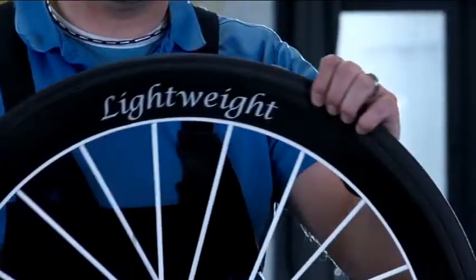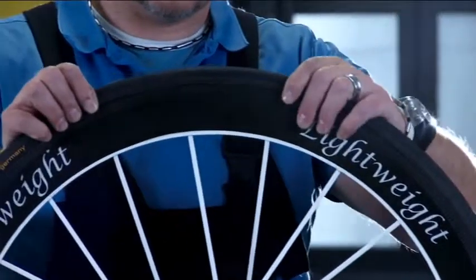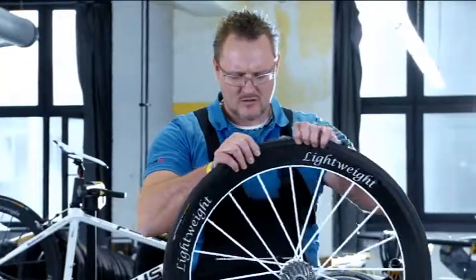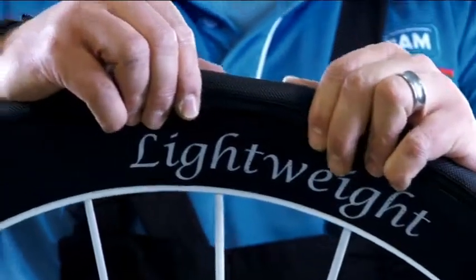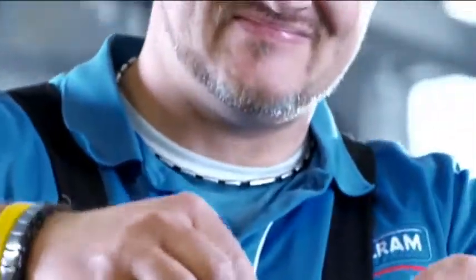Once the tire is in the bed, it must be centered and aligned. Very seldom does the tire run true immediately. Check the tire over the entire circumference. The seam protector must be aligned equally to the left and to the right.